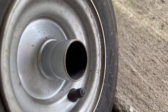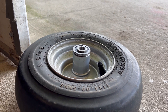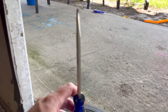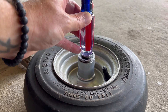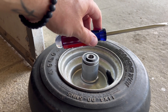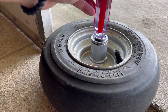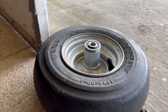I just need to clean the hole out now — the shaft, axle, whatever you want to call it — and then get the new one pushed in. This is actually going in pretty easy. I could take the hammer and slowly tap all around, but what I did is I reversed my screwdriver, put the handle in against the axle, and started tapping on top — it's going in pretty smooth. There are multiple ways to do it: a press presses it straight in, you can flip over a bottle jack with a piece of wood on top, or use a threaded rod with a stack of washers. But this one is pressing in pretty easy, so there we go.